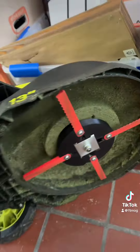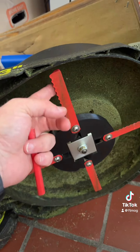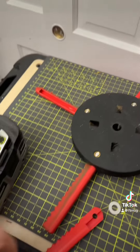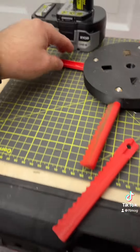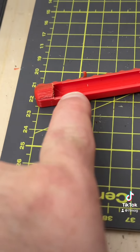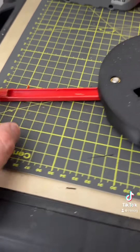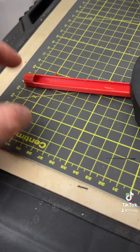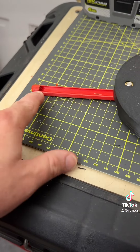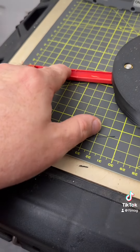Cuts freaking awesome. Now I've got it out to pull it off and look at it — just look at how clean that is in there. I think this does much better airflow than the original metal blade. Looking at it, you can clearly see where the rod came out, and you can see how the layers are separated. Part of that may have been that this was printed a little faster than you should be printing polycarbonate. But honestly, it wouldn't surprise me either — it's just the forces this thing is under that caused it to separate, and then the ballast came out.